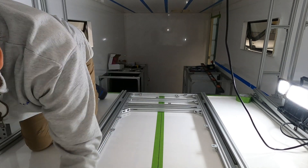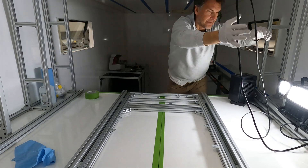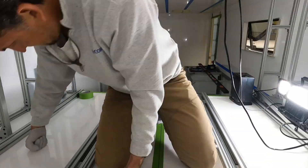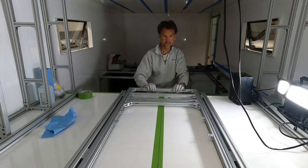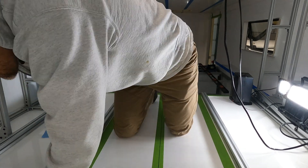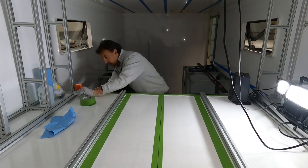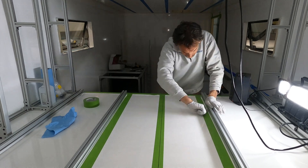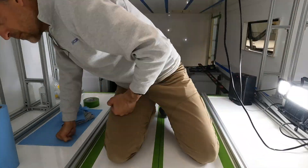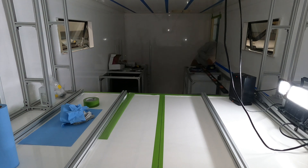The hardest part, really, was not just getting everything exactly well laid out, but also dealing with the cold temperatures in the camper — between about 50 and 55 degrees. Aluminum extrusions and adhesive sealant were both not as soft and pliable as I wanted. After I moved my tape and pushed these things down as hard as I could and got everything perfectly level, I realized the adhesive sealant didn't squish out as nicely as it should have. I'll come back and seal those up to make them a little stronger.